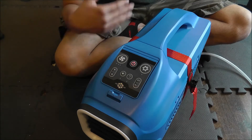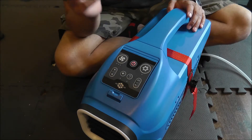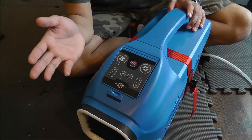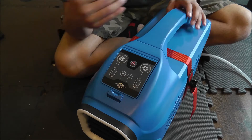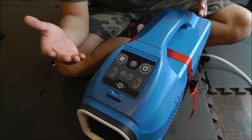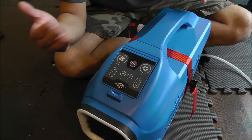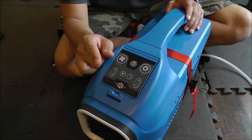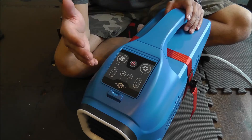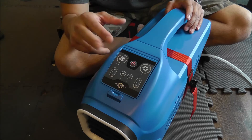So the compressor and the condenser cooling fan would come on but the evaporator fan would not, and as a result it would make a lot of noise but it wouldn't blow any cold air out the front. But there are an equal number of videos where people just don't seem to know how to properly turn the unit on. And because of a small glitch in the programming, it's possible to turn on the compressor without being able to turn on the fan.